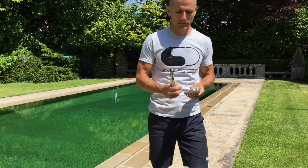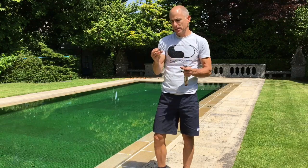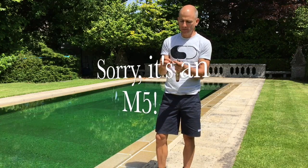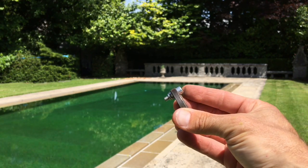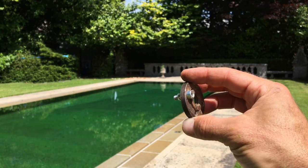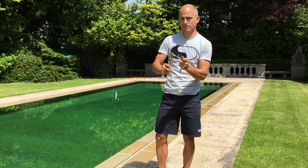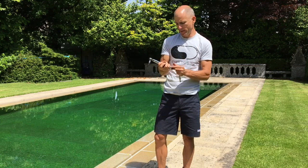What we have here is an aluminium high-quality bicycle bolt, M4 Allen key head, on a steel nut, just threaded through a hole in a basic piece of steel. I'm going to tighten it up aggressively and see if we can make this bolt fail and see where it fails. So at four Newton meters that's fine, let's take it up to six.